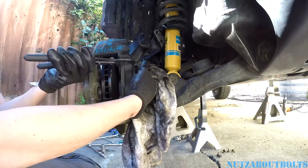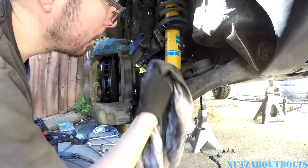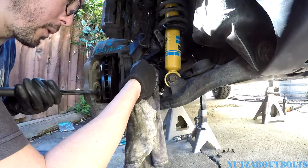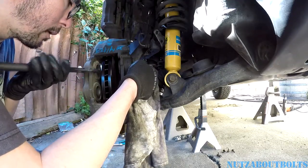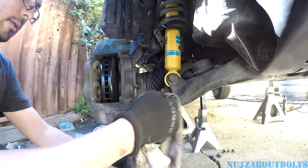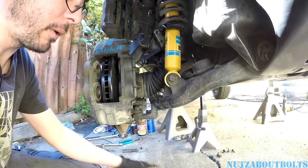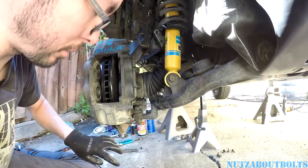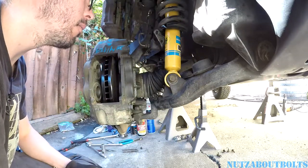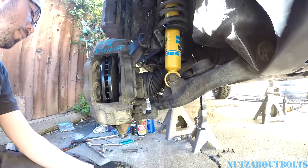Just pushing the pistons in because we are putting brand new brake pads — you need a little more room to get them to fit in there. These pistons should go in pretty easily. Just be careful not to tear those little boots. I didn't want to spray brake fluid everywhere — it wants to shoot all over the place, and I really don't want brake fluid spraying onto my new Bilsteins and peeling all the paint off.